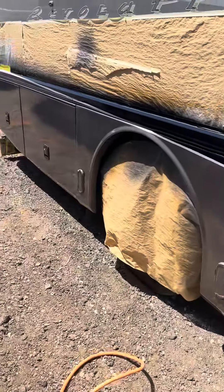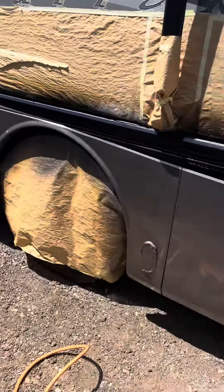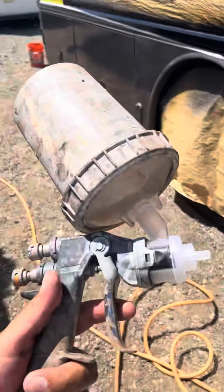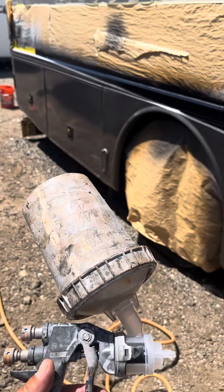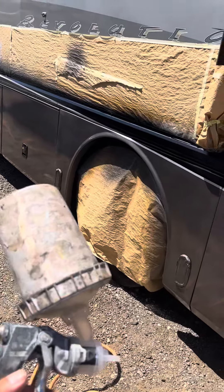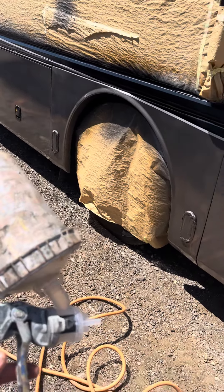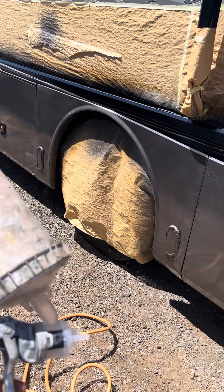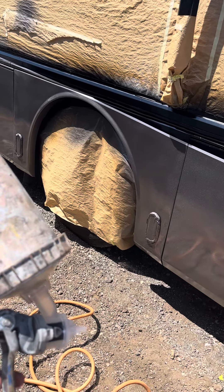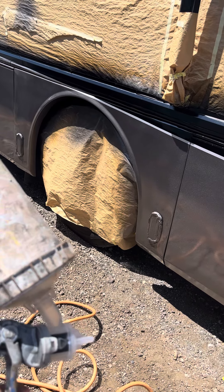So many people are interested in my video about how to spray outside — how do you leave it so clean, how come you don't get dust on the vehicle. So I'll go over it again. First of all, my pressure is set at 20 PSI. I do go a little higher sometimes. The clear coat is mixed 50% reduced.